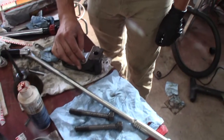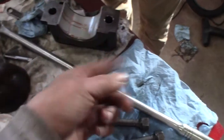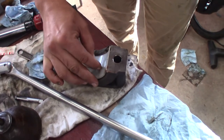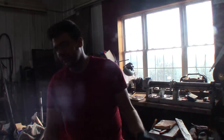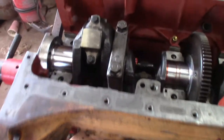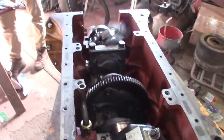All we did was take the transfer marks off the crank — that was the big thing. These bearings didn't spin repeatedly. It was obvious — they spun once. The story was the bulldozer got flopped over on its side while it was idling and it stopped running. They were seized on there — the motor didn't spin until I started taking things apart. We'll continue on with this saga and see what happens.